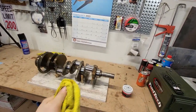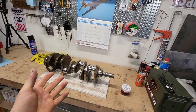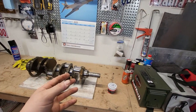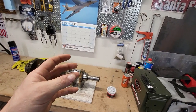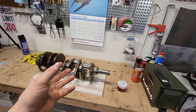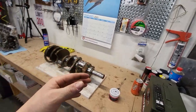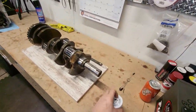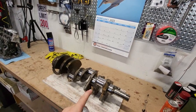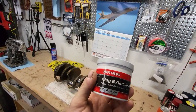This is the type of stuff I do just to pass the time — watching some Street Outlaws videos or whatever out in the garage. If you're into doing stuff yourself, there's no reason you can't just tear into things and start getting after it. There's no right or wrong way — well, I guess there is kind of a wrong way — but there's no limit to what you can or can't do yourself. You can pay someone else to do this, but the satisfaction of doing it yourself, even if it's not quite exactly perfect, is worth it to me. I got no interest in taking my stuff to someone else's shop. A half hour per journal — you could do an entire motorcycle crank. I was doing the mains and all the rod journals on a motorcycle crank in I don't know, a couple hours. Throw on a movie and just start polishing.